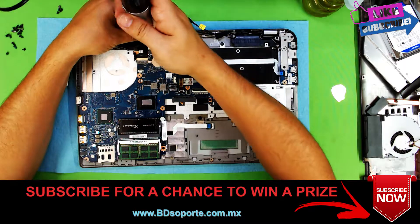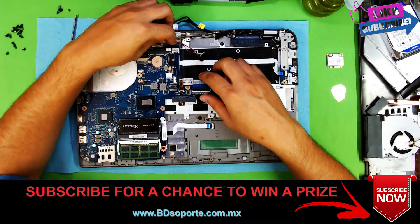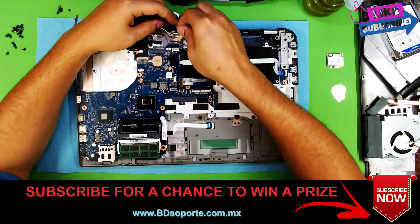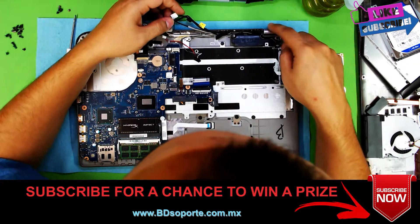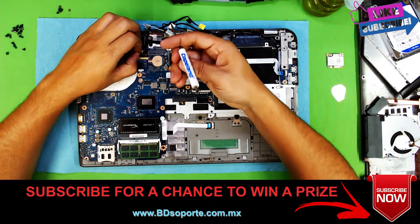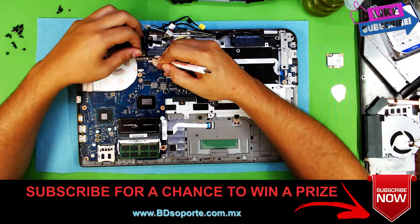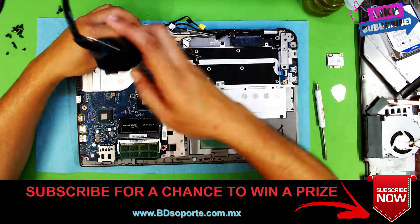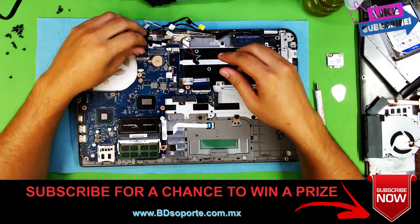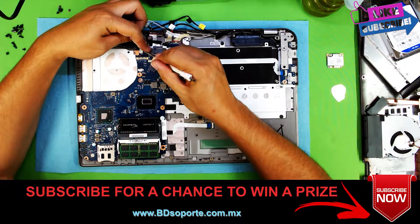First I'm going to remove the Wi-Fi card. I'm removing one screw at a 45 degree angle and pulling it out. Then unhook the cable that goes to the USB and goes to the screen. You'll also want to unhook the cable for the screen — pull it from the side, don't yank the cable or you'll damage the jack. There's a ground cable attached to the screw beside it; remove that too.